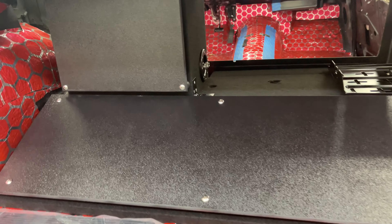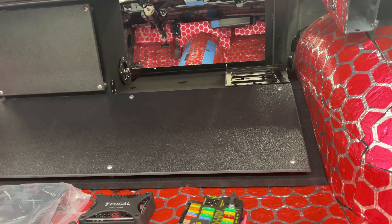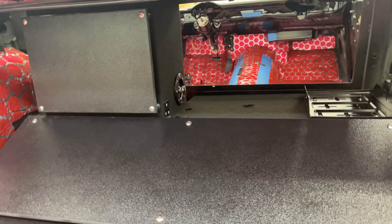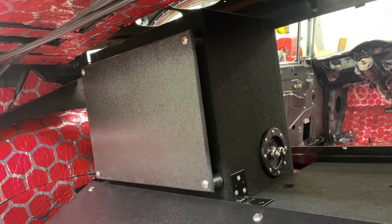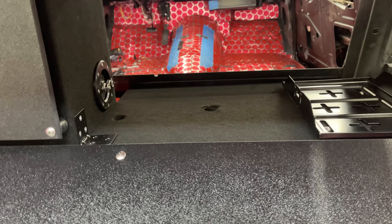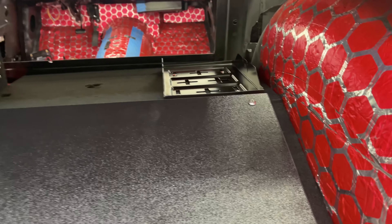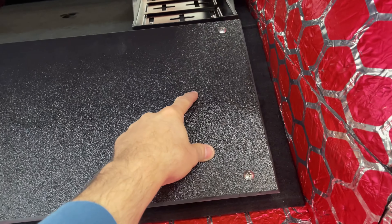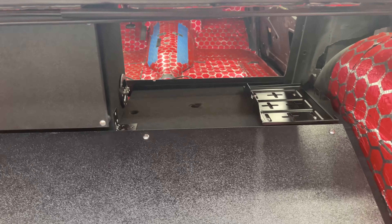All of the MDF is covered and wrapped. I've drilled mounting holes, countersunk them, and on the backside there are nutserts into the body. The plastic here is PVC quarter inch with one inch rubber standoffs. Everything's getting mounted — I've got a hole in the center for wires to go down above the rear end with a grommet. The battery goes there, the fuse block is likely going somewhere here on this side, with a couple of fuses and distribution blocks in the middle. Then the wires will split, some down the middle and some around the side.